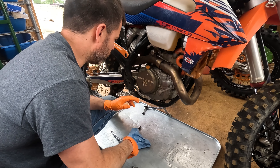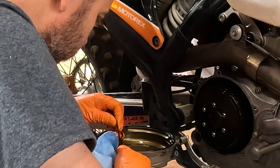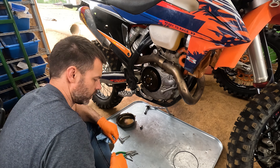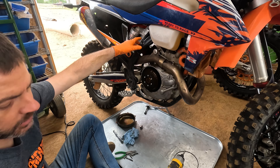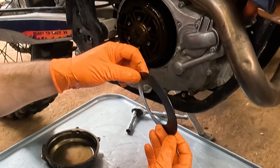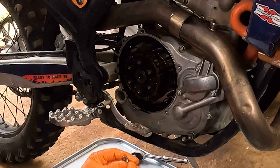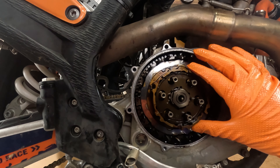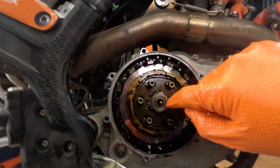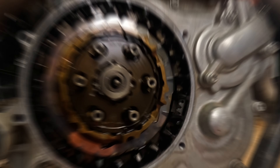The oil is drained and we're pulling the clutch cover. I don't immediately see anything wrong, so let's pull the Belleville spring, collar, Belleville spring, and pressure plate. You don't want to drop these pins in the engine. The bushings in these things actually make quite a bit of difference and there should not be play like this — if you look past these pins you can see where they hit the bushings and there's just a ton of play. So this stack has got to come out.